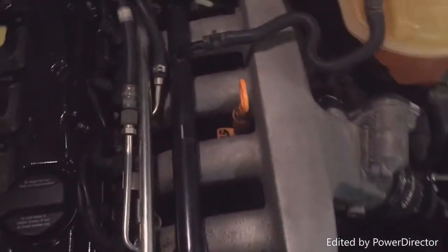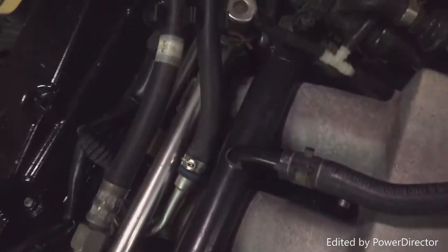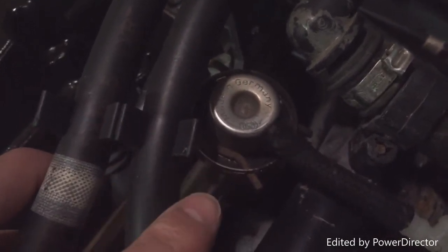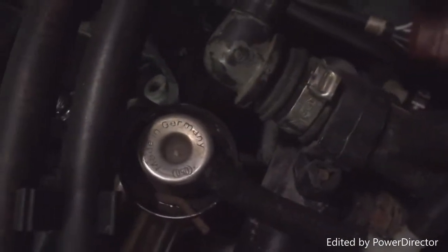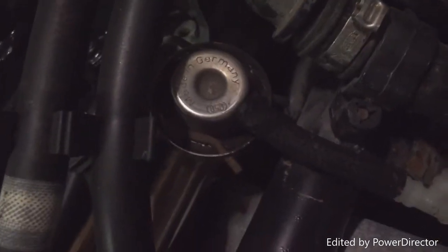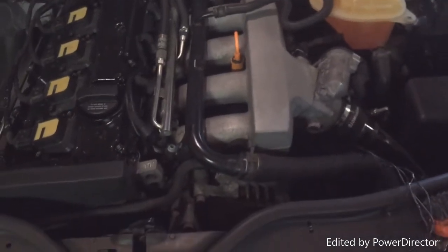What I will be doing soon, and what you should do if you're running 15 or 16 pounds of boost without a tune, is right back here on your fuel rail — that's your fuel pressure regulator. I think this is a 2 bar fuel pressure regulator and you can get them on eBay and Amazon for like 20 to 40 bucks. You need to get a 4 bar fuel pressure regulator. There's a little clip around it that just slides off, then you pull out the vacuum line, pull it out, and drop a new one right in. You'll have a little more fuel pressure and it's a lot safer that way.